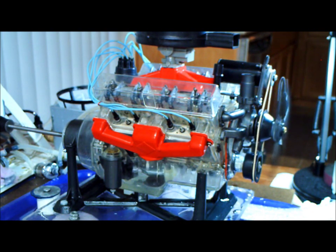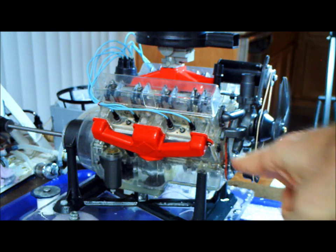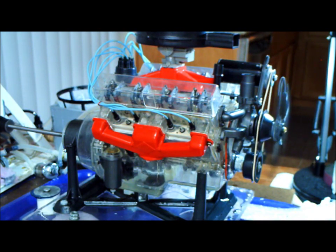That's running pretty good. Once the oil gets a little warmer, it'll stop leaking around here. When the lubricant is cold, it has a tendency to wrap around the crankshaft and come out around the front of the crankshaft. It is quieting down, so it looks like we did a pretty good job assembling it. We've still got about 14 pounds oil pressure. We'll rev it up one more time.